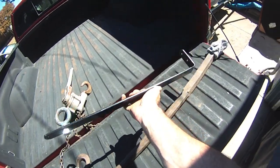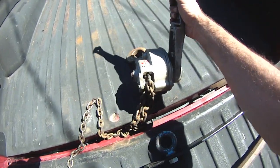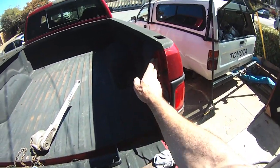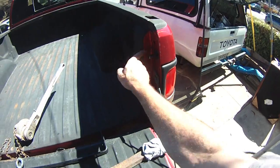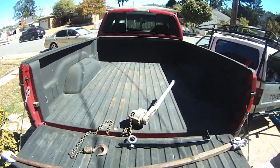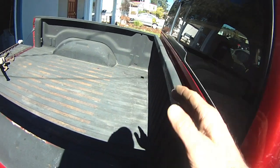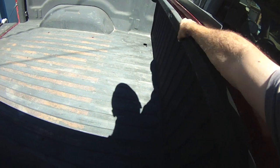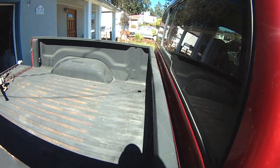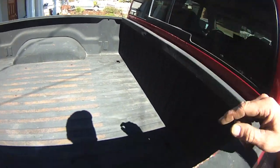I dug through my hoard for a piece of steel, drilled the hole out a little bigger so I could put this welded eye loop. I think it's a three-quarter ton chain come-along and a good old-fashioned pry bar - this is the perfect length to fit right in here. I just cut some one-by-three furring strips from scrap, put a couple socks on the end so I wouldn't scratch the paint. I can't get to pulling that dent back up with a slide hammer - it's the front of the bed - so I'm just gonna clean that up.